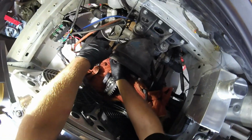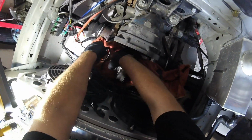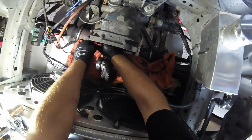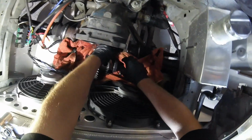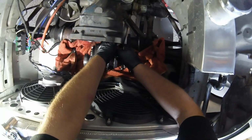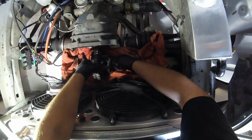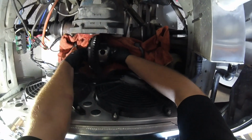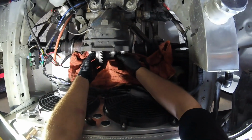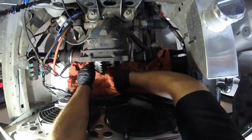Embarrassing faces all round. Right, so the advantage of putting grease on those bearings is they will stay put while you try and assemble the thing. They won't just fall off at every single opportunity, which is what happens otherwise. It's a bit of a challenge to get it all assembled. So, watching for fingers, etc. Can't be as easy as that, surely.